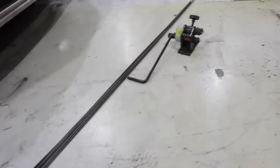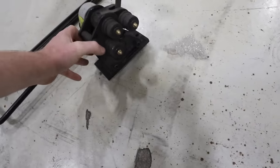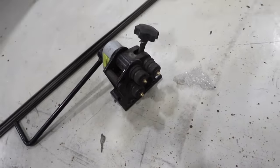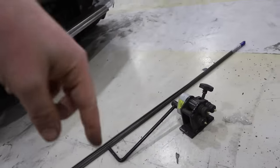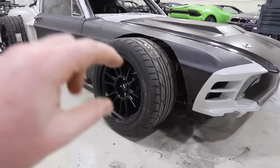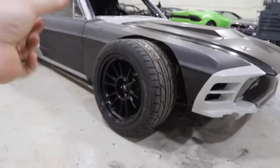The way we get perfect bends is by using a roller and then matching it up with circular things. So as you feed that rod through here, you can crank this thing down, roll it through, and it will shape it into a circle. So some of the base points for a body kit is you need that flat section that follows your wheel and your tire arch.